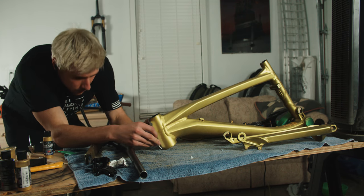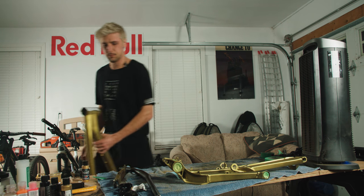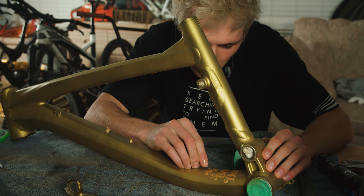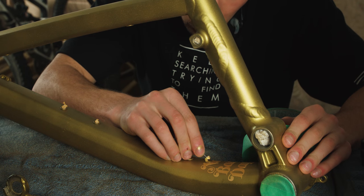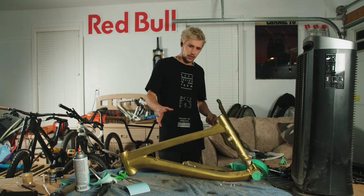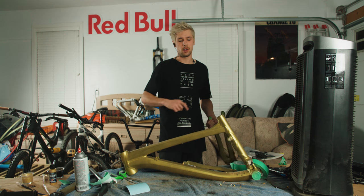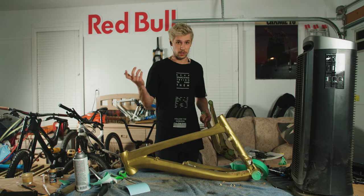It's time to dry this baby out. The decal idea on the front didn't really pan out — as I peeled it off it ripped the paint off. Oh no, same thing is happening here. If you're doing this sort of DIY home paint job and you're not sandblasting it, primer, then painting — just wait until you put on decals at the end. Otherwise you're gonna be ripping paint off.